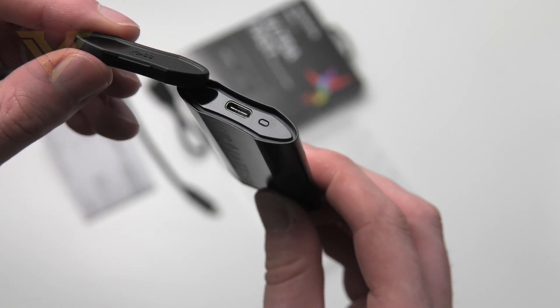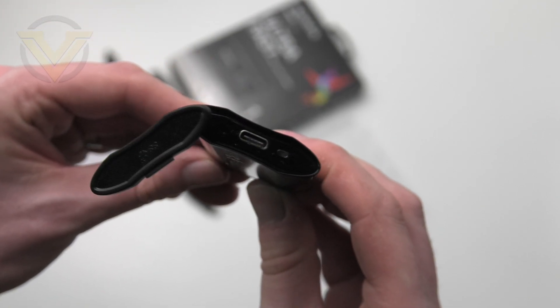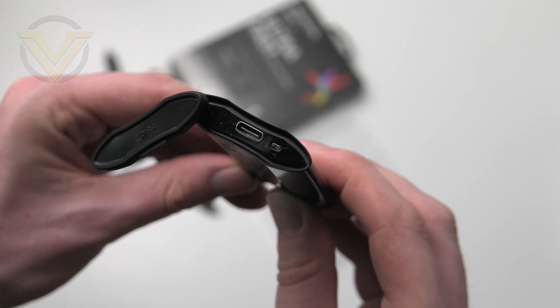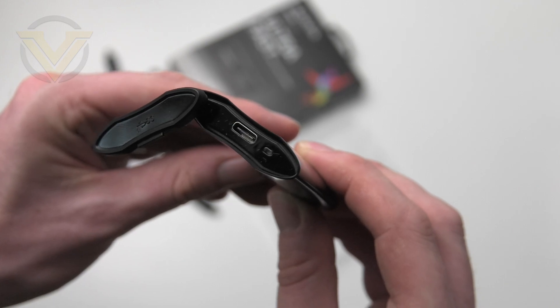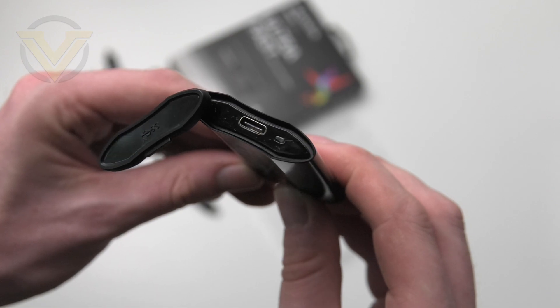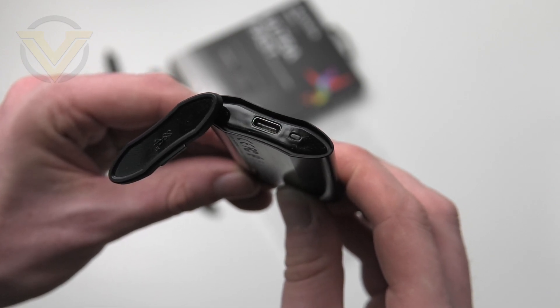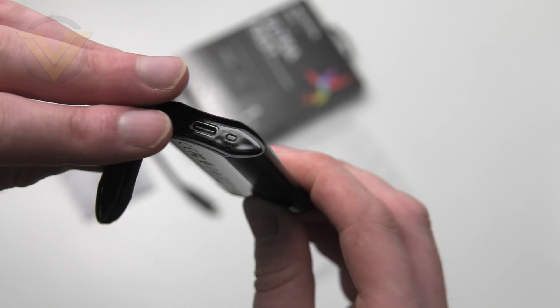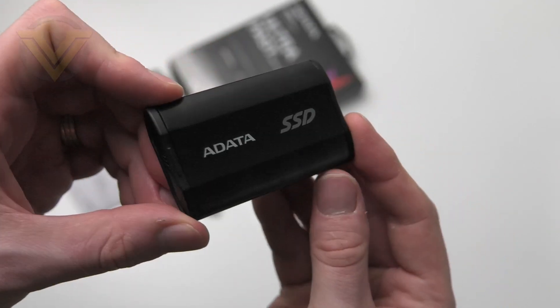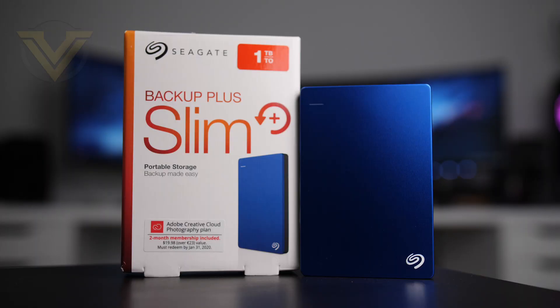The port at the end of the drive is concealed with a plastic cover which unclips and can be pulled to the side to reveal the USB-C port with the activity LED. This drive is USB 3.2 Gen 2, which provides up to 10 gigabits. To take full advantage and get the best transfer rates you will need to be using a USB 3.2 Gen 2 port with UASP mode enabled. This drive will work with USB 3.2 Gen 1 (otherwise known as USB 3) but it will be kept to those slower speeds. Let's jump in and see how this drive performs against the popular Seagate Backup Plus Slim.